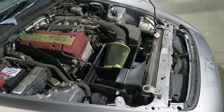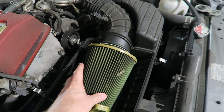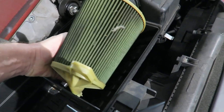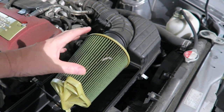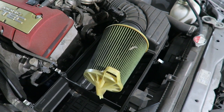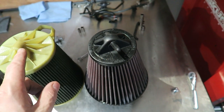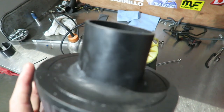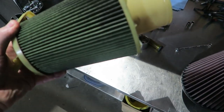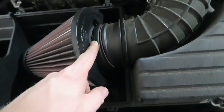The filter is really bad — it's a good idea to replace it with a K&N replacement filter. The K&N filter is not the whole arm and assembly; it just replaces this filter right here. It's a direct replacement — it pushes in, has a little tab, fits right back in the same spot, and is the right length. It's an improvement over the factory one, and it's cleanable so you don't have to buy a new filter in the future. You can see it's got the same pin, lines back up, and pushes in just the same — makes your life much easier.